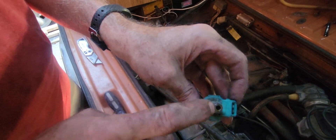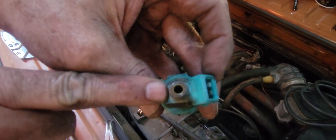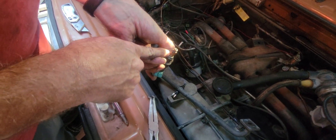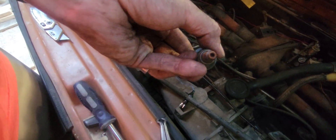Inside here there's a little filter. You can see the brass inside the metal — that brass thing is actually a small filter that drops in there. And then this is the area that squirts. This is an interesting pintle cap — it's kind of strange that it doesn't have the small hole like you usually see. Inside the center there's the pin that pulls back when you electrify it. That's kind of how it's made.